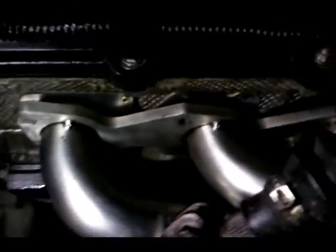Make sure you put the gasket on there when you do it. This helps it stay there while you're doing the rest of this. Alright. Before you put the bolts on, you want to make sure you put the anti-seize on. Just gotta find mine. Hopefully you know how to apply anti-seize. It's pretty easy. You just put the first through shoe in, bring it up through the bottom.